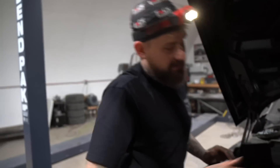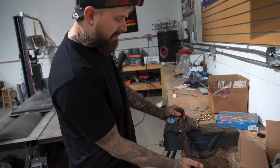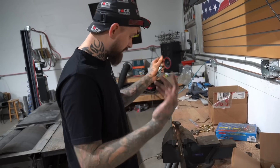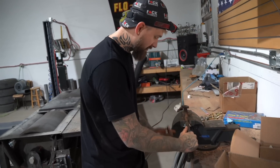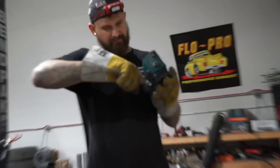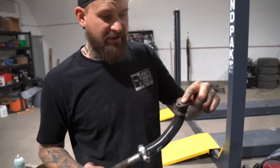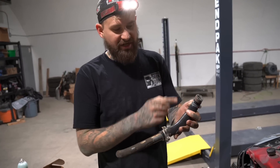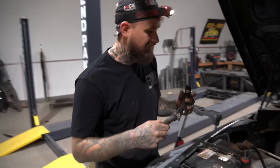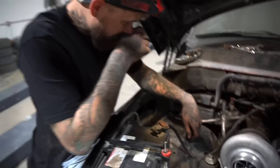It's a learning experience — kind of like trying to make chicken soup out of chicken. The plan is to heat it up and bend it just a little bit, then do the opposite on the other side. I hope we don't totally wreck it. So this is actually the factory drain pipe — we just cut a chunk out, used a hose section, and now it's not touching anything. It's going to work mint as long as it doesn't leak. We got the drain plug in, it all looks good, we can start bolting stuff up.